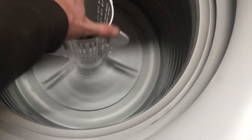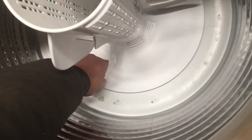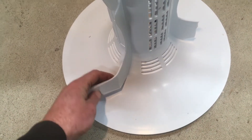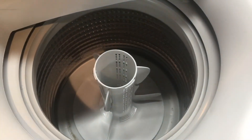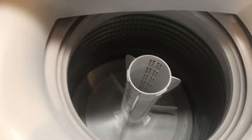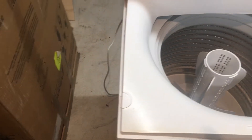The agitator itself has three fins — they should all be straight. We're looking for bend marks where they've specifically bent like this one has done here, or snapped right off and caught on washing. There may also be marks on the agitator from that. On machines that have seen heavier use you'll see it the other way as well. This one looks good.